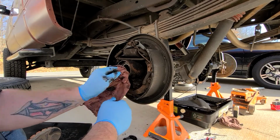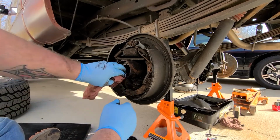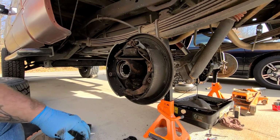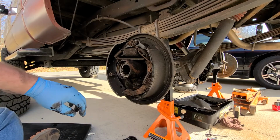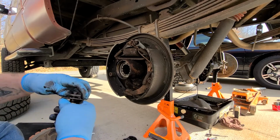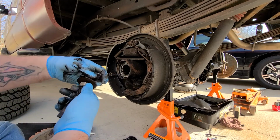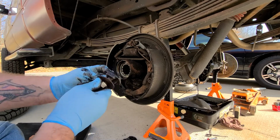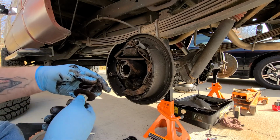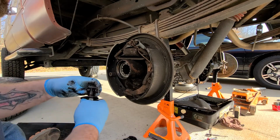Now these bearings don't look too bad. But, you know, usually I'm with, if it ain't broke, don't fix it. But considering the age of most of this stuff. So, I have these nice puller sets. And how these work is this goes in like that, and then you swing it out behind it and pull it, and then put this cover in front of it and you drive this nut back down. The trick is finding the right size for the bearing you're using.